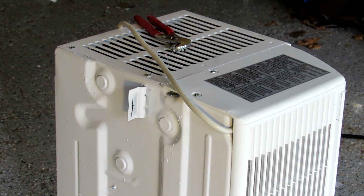I can drill holes. Now, of course, if you're changing from a factory install, then all you need to do is bend these little tabs down and push the air conditioner into the hole, and just drill where you are. Just pick a nice central spot in the tabs and drill into the tab. You don't want to drill too far into the aluminum.